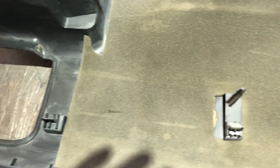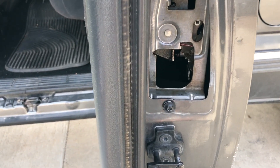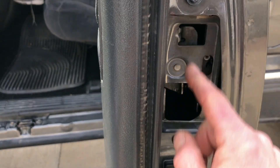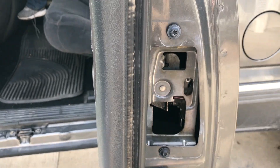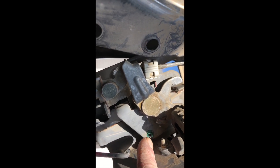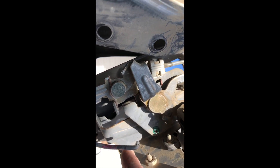They're all throughout the door. And here's where the door handle goes — my door handle is also broken. Just take these two screws out and the door handle pulls right out. And now here is what's actually broken: that little green clip broke, so the metal rod wouldn't stay in there.